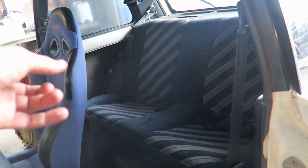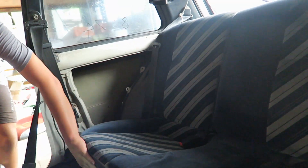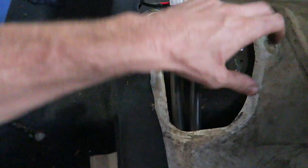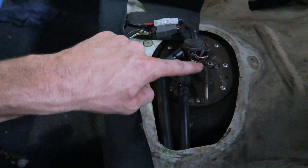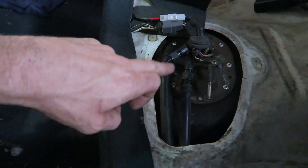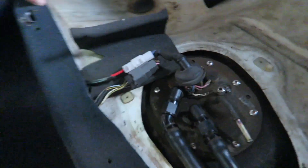Come around that other side and flip the seat forward. I'll flip the sender up. So the fuel top comes out — the standard one has a breather, and it usually has another one that's a bit bigger for the fuel line, and then another one about the same size which is the return line. I wanted to run bigger ones for this car so I drilled them out and got those fittings put in there.